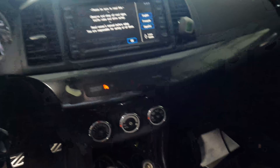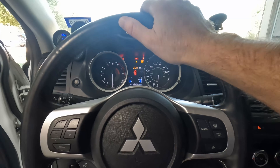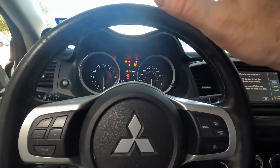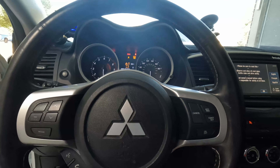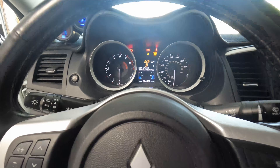I think I've figured out the issue. The problem is that even though you do a recalibration, the steering angle sensor still has to be somewhat in range. If the wheel gets turned a couple of times or even once, it's definitely going to be out of range. What I'm going to do is disconnect the shaft down here where I originally disconnected it. While it's disconnected, I'll take the wheel, turn it, try to get it straight again. I know that the splines are lined up correctly, so as long as I can get it back in range it should line up perfectly. In theory it sounds great — hopefully it works, but we'll see.